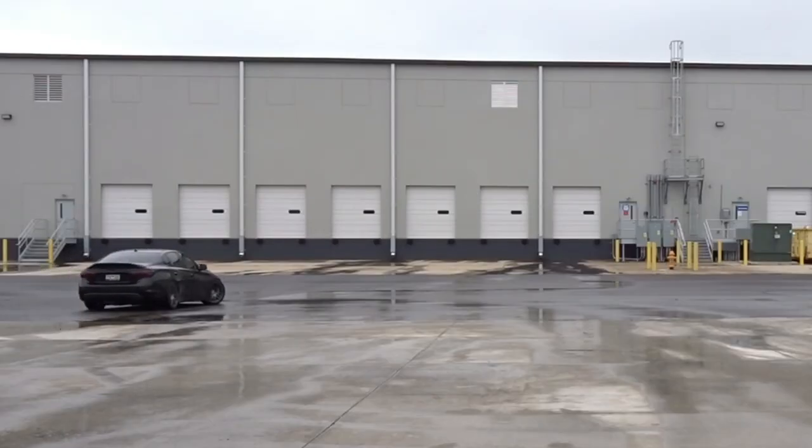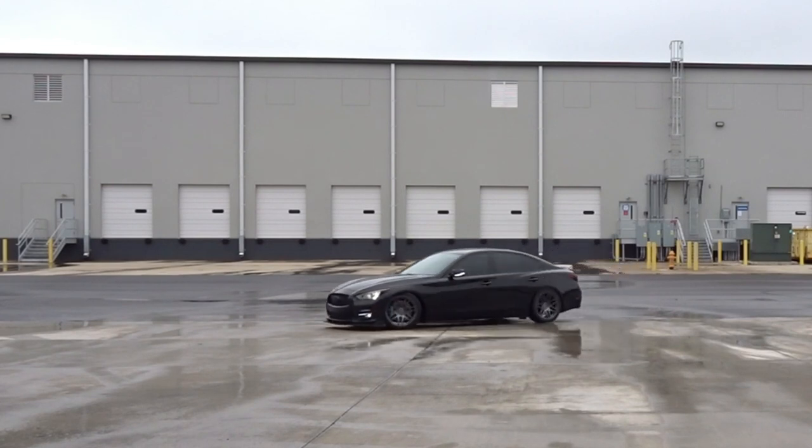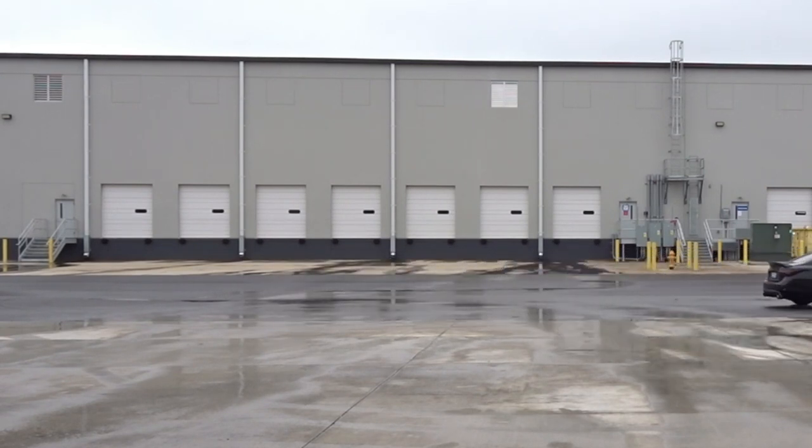So here I am in this little parking lot doing some tight corners, figure eights, just seeing if I can hear anything. Like Traction Concepts says, this is an LSD conversion kit so it should act like an LSD — it should allow you to drive normally in situations like this, doing tight figure eights without any skipping, squeaking, or squealing. But when you really start to spin or push the car, pressure should be applied to those spider gears and kind of lock the rear end and spin both tires — that's the goal.